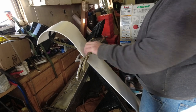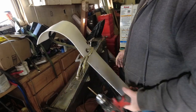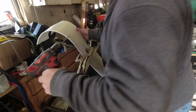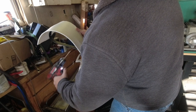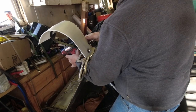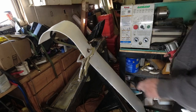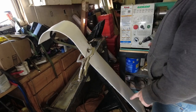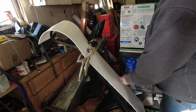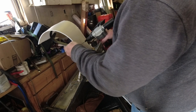I've got the ski skin strapped down here with some big vise-grip C-clamps. Now we need to back-drill through some of these holes. By back-drilling I mean that we've got an underlying structure and we drill out through the top surface. With the skeg mounted in here, we'll be able to drill the skeg holes in at a later date. I think we can just start putting the rivets to this thing.